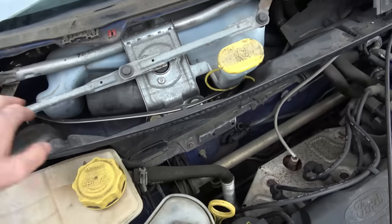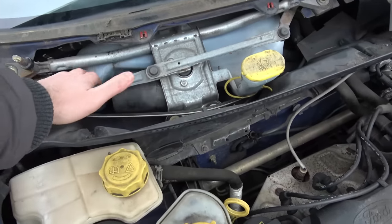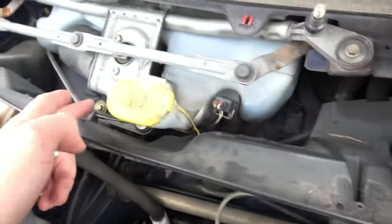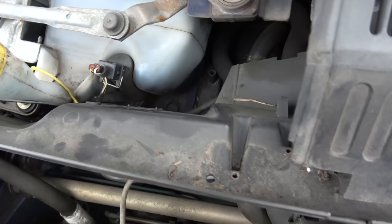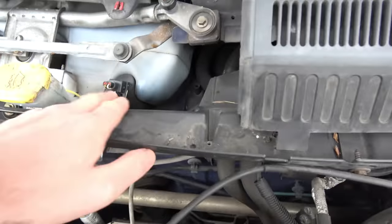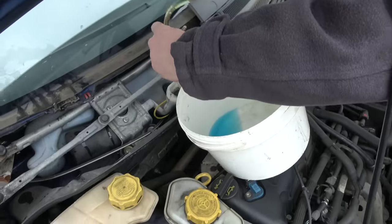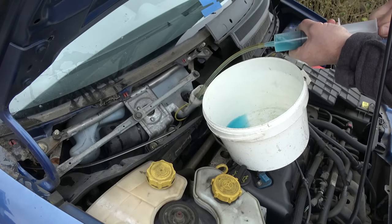We're wondering what to do. We could undo those connections and take out the whole assembly along with the wiper assembly and washer bottle. But we're thinking it has to be something to do with the motor, because it's not going either way - if it was a blockage on this pipe it should still feed the other one. The fact it's not feeding either of them means the motor is either blocked at the inlet or not working properly. So we're going to siphon off all the fluid first because it's completely full, then take the motor out.